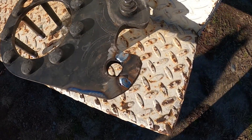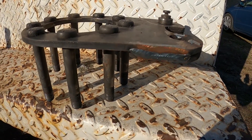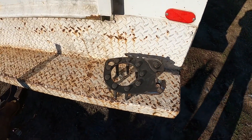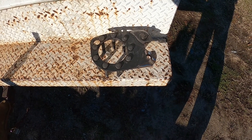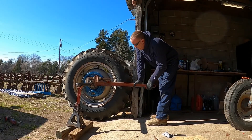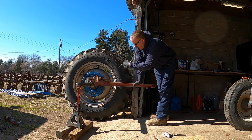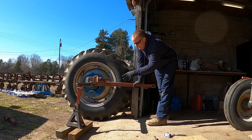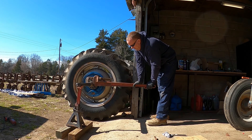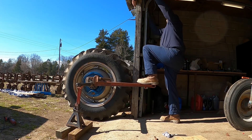The camera's probably not picking that up, but I beat in here and in there. Ran a small bead down there, so I'm going to let that cool off and call it a day. Get back on it Monday and bring you guys back then. Stay tuned. We've all seen the short that I posted — this is our setup. Just bolted the axle assembly back in with the wheel backwards, got the tire up against the building here supporting the axle out there with a jack stand, then 250 foot-pounds — so I'm at 245, we'll see what we can do.